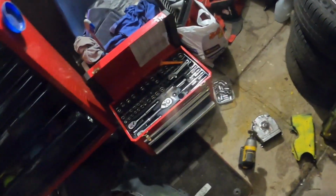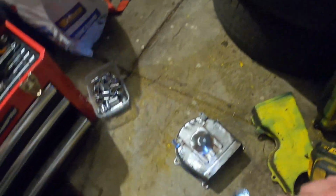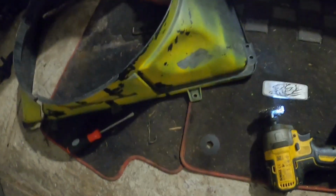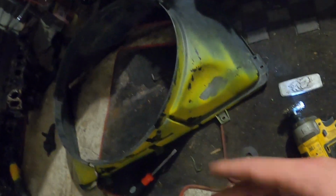But yeah, so first things first is the wire wheel. Probably not the safest option for these, but for metal I feel like it'll be okay if I'm priming it straight away. I'm going to sand it, give it one sand over so there won't be those marks in there. And also with this, see what it looks like. It's just going to leave marks in it. Give it a sand over, might do an alright job, and might just sand it all actually, instead of the wire wheel. But yeah, alright, well, try this on time lapse and I'll see you guys soon.